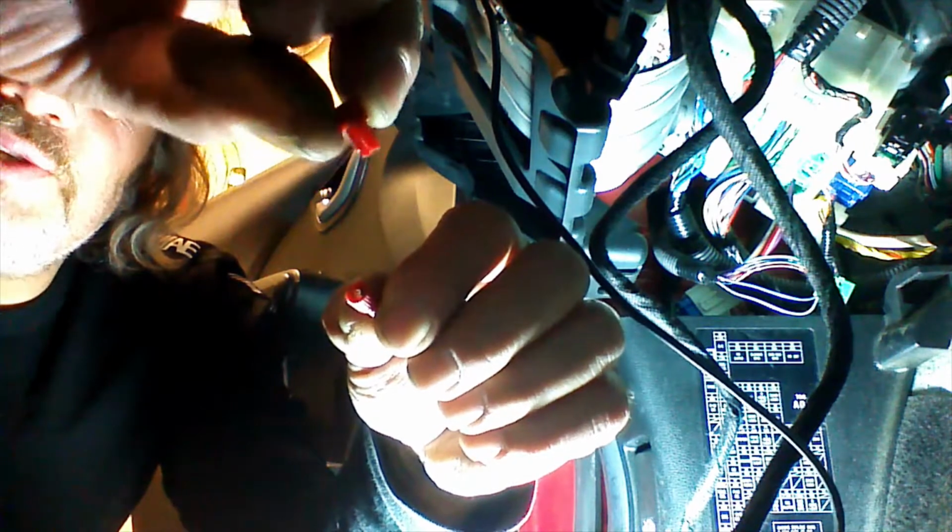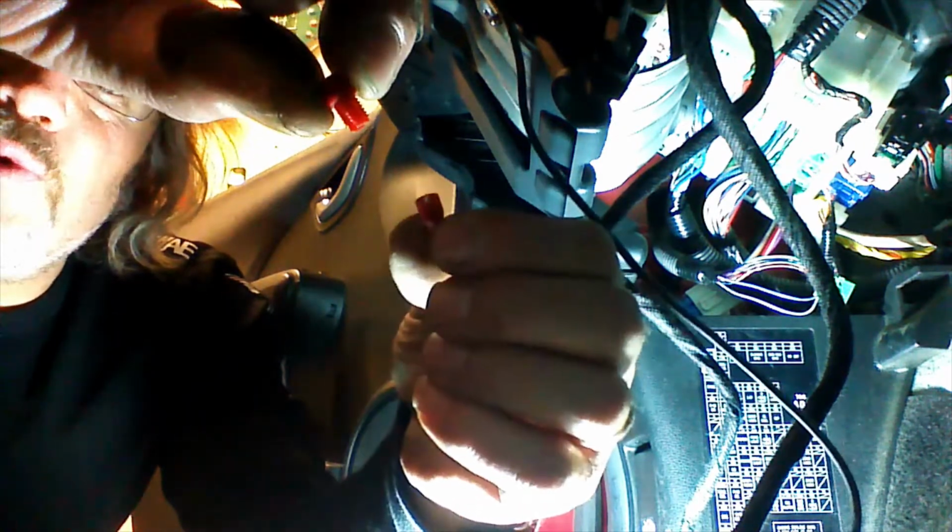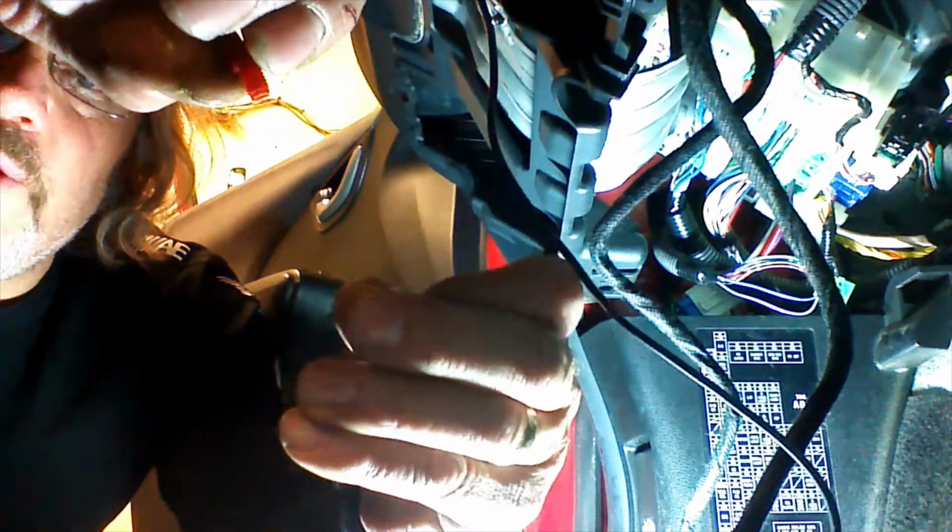We're going to place this groove piece over the wire. We're going to screw it back together. The needle will pierce the wire, giving us a connection point. So we're going to start with a lock wire, which is light blue. We have it isolated. And again, I'm going to give you a close-up when I'm done. I just want to get through the tapping part.